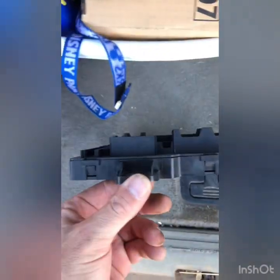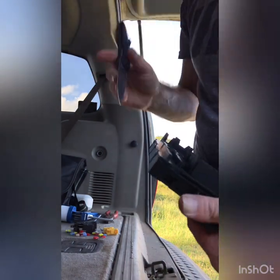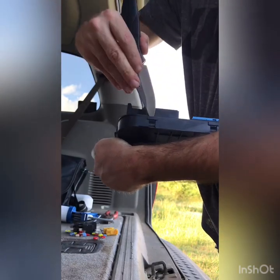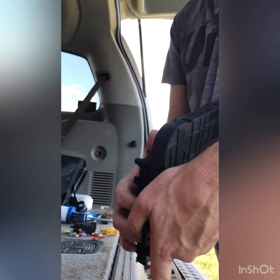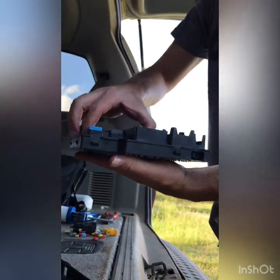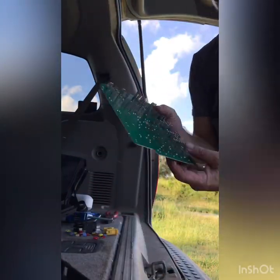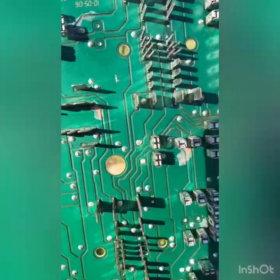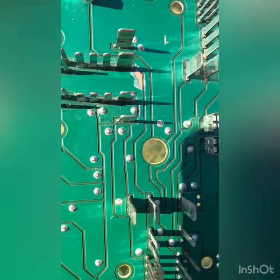Pull all of your components out, then it's time to break this thing apart. It's got clips around it and I just start on one corner. I just start on one corner with my knife — though I would recommend using a flathead screwdriver, this is kind of dangerous. Just work it around. You just can't let one go back in because it'll all fall back in. Once you get them worked around that far it just falls apart and all these forks just slide out. This one's got water on it again — you can see the water's still running out of my harnesses and components. What would happen is the water would get in between the dividers between the boards and they would jump the circuit and it turns black.